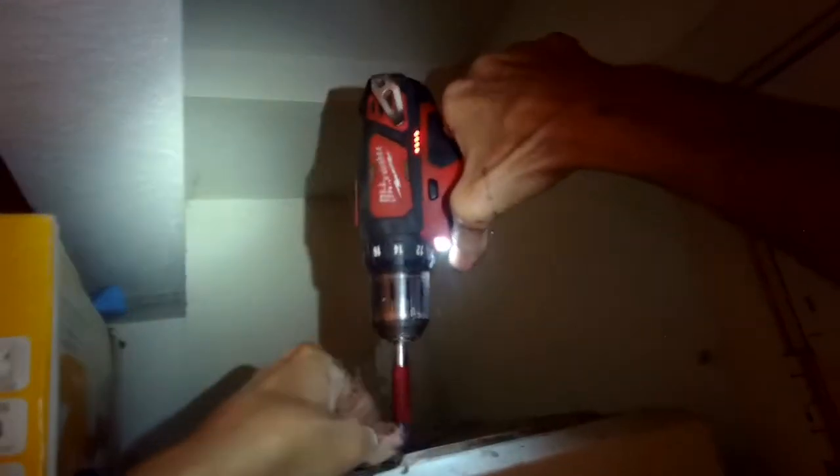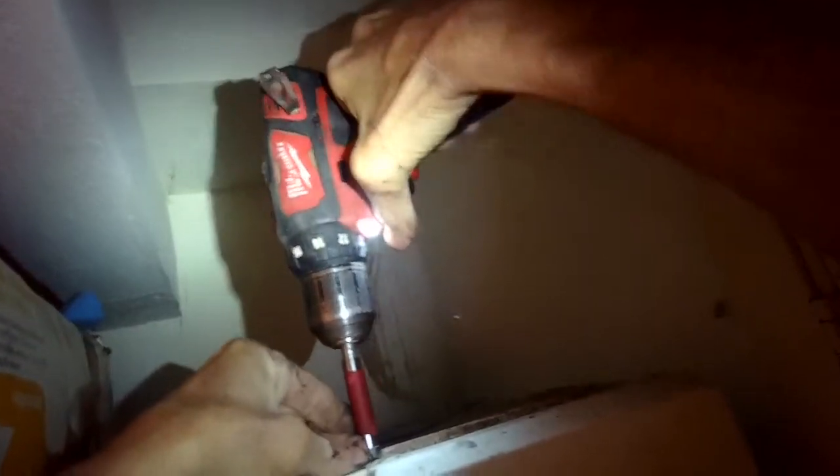But there is a plastic piece that'll be kind of caught underneath the tumbler. So it's flexible, so you just want to carefully pull that towards you, and then the whole panel will come off. And then you can get the tumbler off. First you want to reach in underneath, make sure it's unplugged, and you want to push the idler wheel to the side so you can get the belt off of the motor pulley.